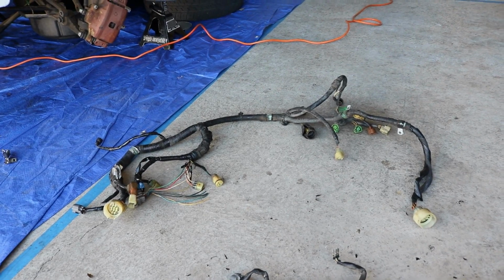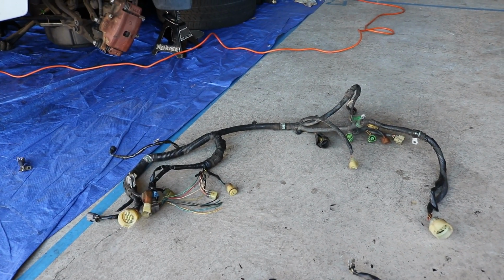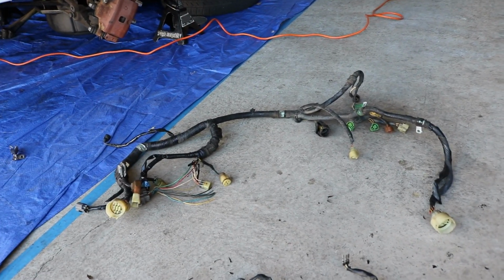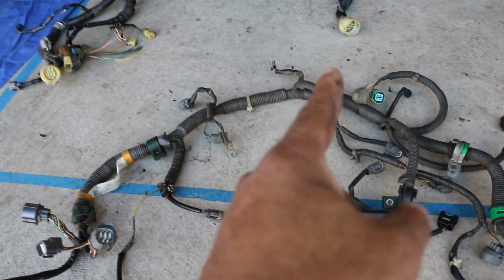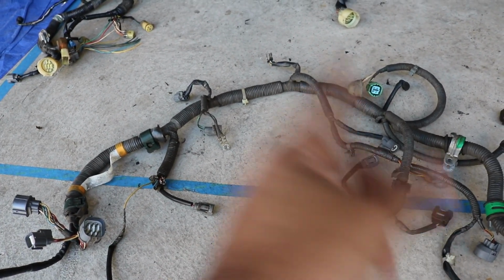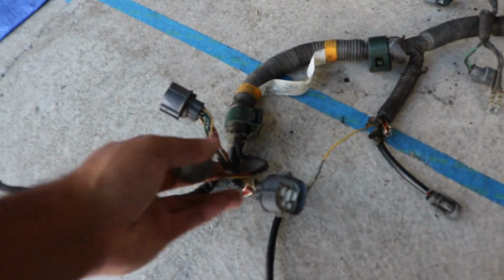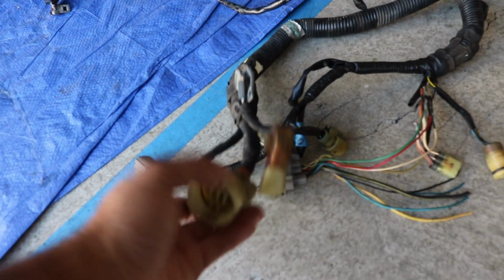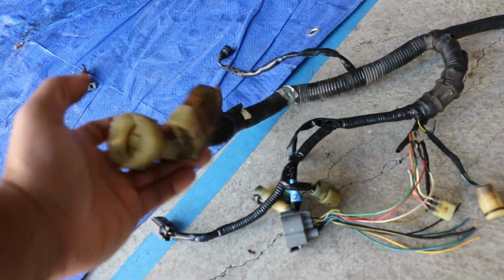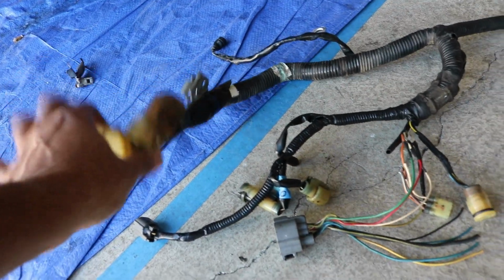And I don't like when there's a bunch of random wires just running, you know, all over the place. It just looks terrible. So in reality, it'd be fantastic to just be able to use this harness since it plugs into all the sensors already. However, the trouble with that is these shock tower connectors, for obvious reasons, are very different than these. So just use your stock EF harness because this already plugs into the chassis and everything is there.